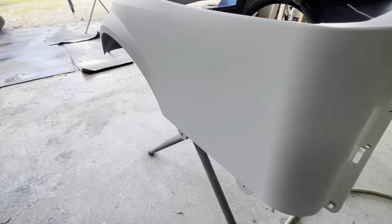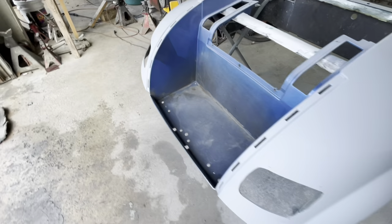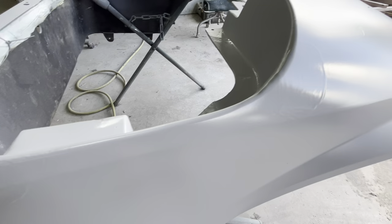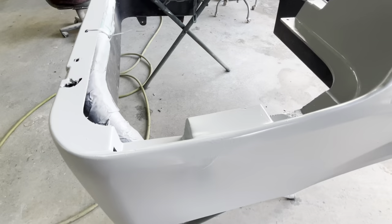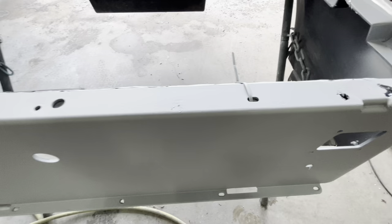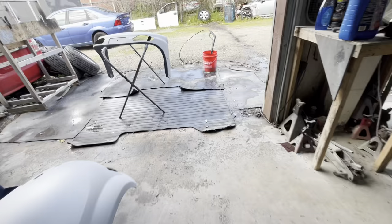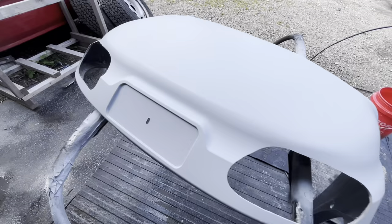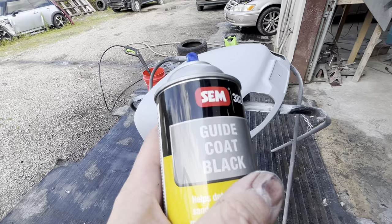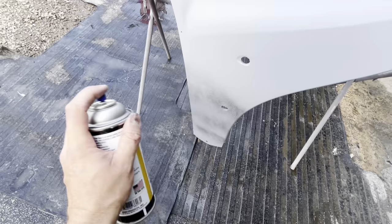We got that thing primed all out. This should fill in all of your lines that were in there before. Ignore my run right here — I had a pinhole I got mad at and hammered it on there. Had another little sag, but inside here looks pretty good. We pounded a lot of primer on top and we're going to block all of our primer out and sand it. Next step is to lay some guide coat on it — part number 382030. This just allows you to see what you're doing when you go to sand, so you can see your imperfections.